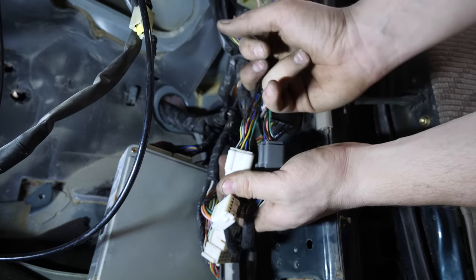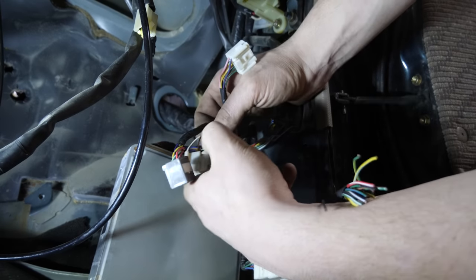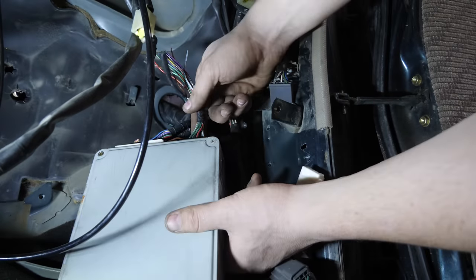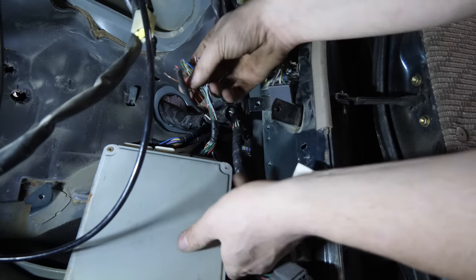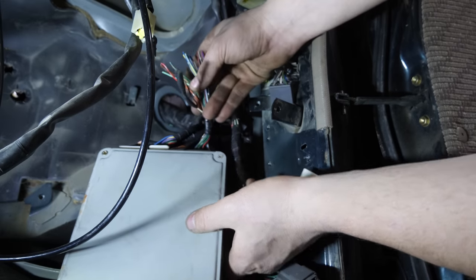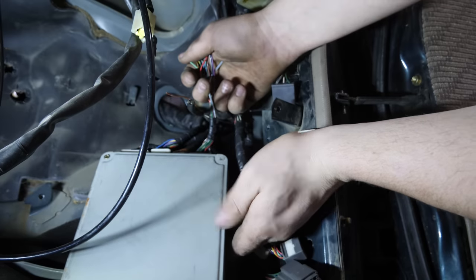These ends were cut off that 3-liter engine harness. So yeah, I'll just have to cut these guys. I'll probably find some plugs so that I can make it more of an adapter harness instead of just hardwiring everything. Oh, and this last plug going into the ECM was sent to us exactly like this. This would have been cut off the body harness that the 3.4 came with. And this is where we will give the ECM power, switch power, the OBD2 port comes through this, and I think that's it, but let's look at the diagrams and figure that out.